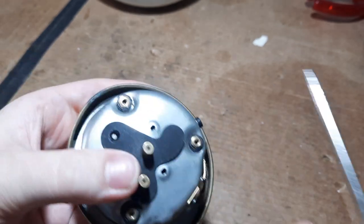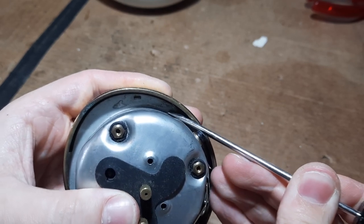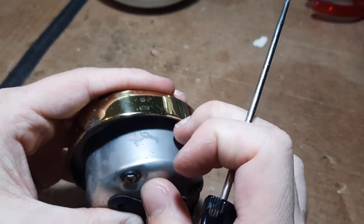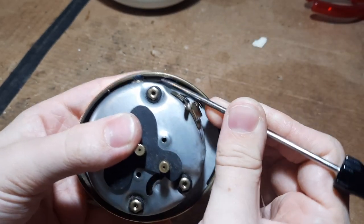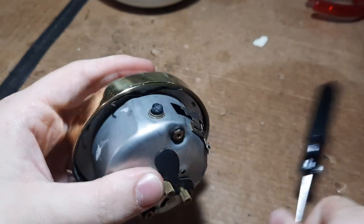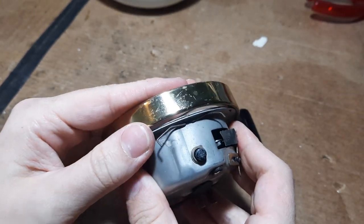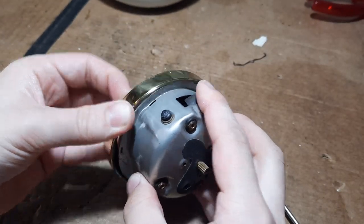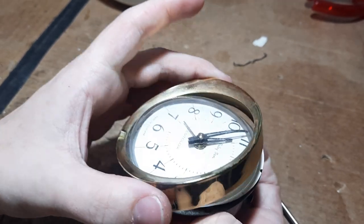You see this clip in here? See this metal spring? This is an annoying thing. The idea is you push down on the ends of the spring and try to get the very tips of it to come out of the bezel so they're no longer stuck under there. Push it down and hook it out - just like that. Now we have both ends of the spring on the outside. Then squeeze the bezel on the ends and unhook it. Careful with the lens.